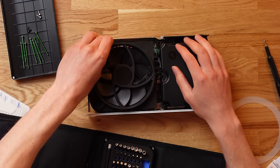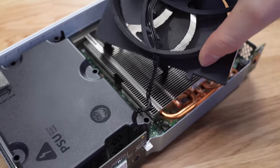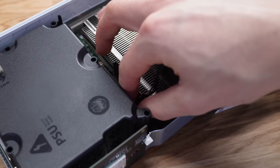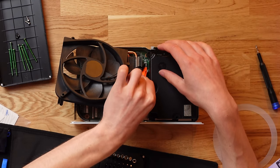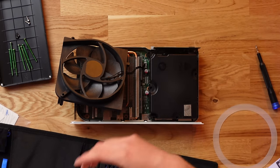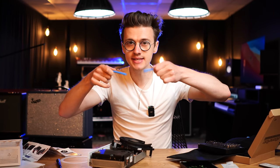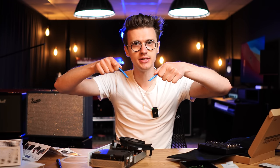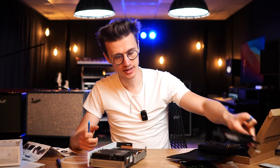Remove the fan screws carefully — you don't want to grab it aggressively. This removes the heat sink, and then we disconnect the fan from the fan header. Using the good quality prying tools from the iFixit toolkit, just wiggle it out gently — you don't need to ram it aggressively, it should just ease out with a little wiggle. Now our fan is completely free.